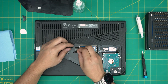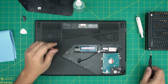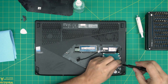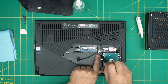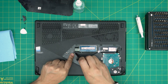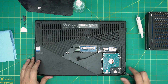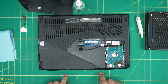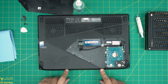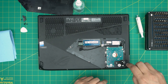Now we're going to disconnect the hard drive — lift up the flip connector and pull it upward, untangle the cable and bring it to one side. Remove the screw right here, then the screw over here, and the screw by the jack where you disconnected the hard drive. Once those are removed, go ahead and remove the screws all around — the two screws in the front corners are the short ones, the medium screws are mid-front, and the rest are the longest.